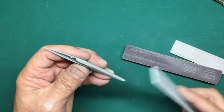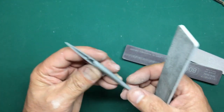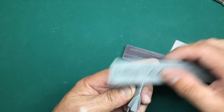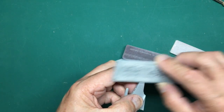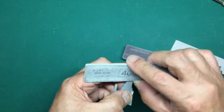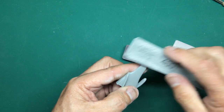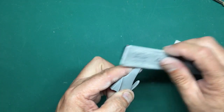And that's the only way you're going to get a straight edge. You're never going to get a straight edge by using a sponge. So yeah, use the hard sticks, get in there, straighten it all out. Same on the back here, get in there with a hard stick, straighten it all out. Job done. And again, I'm going to remove those panel lines from there because we've removed half of them on the seam, so we may as well remove the rest of them, just like so.